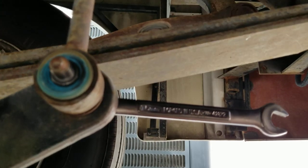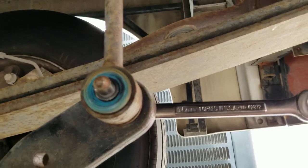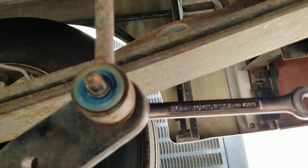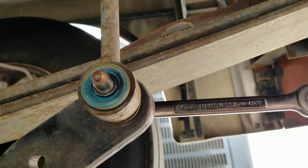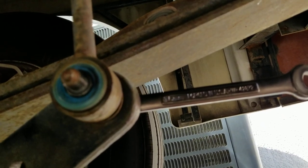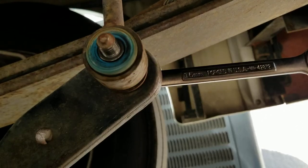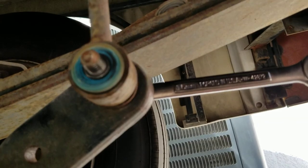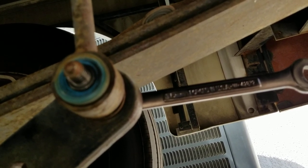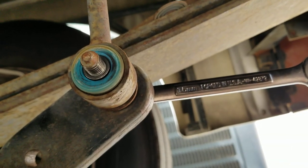Today is another episode of 'Now You Know' and this deals with the so-called Cheap Handling Fix, or CHF. This applies to Class A motorhomes that sit on the Ford F53 chassis. Ford sends out these chassis frames to the motorhome coach builders on the soft suspension setting because they don't know what the weight of the box built upon them will be, and most coach builders probably don't make final adjustments.